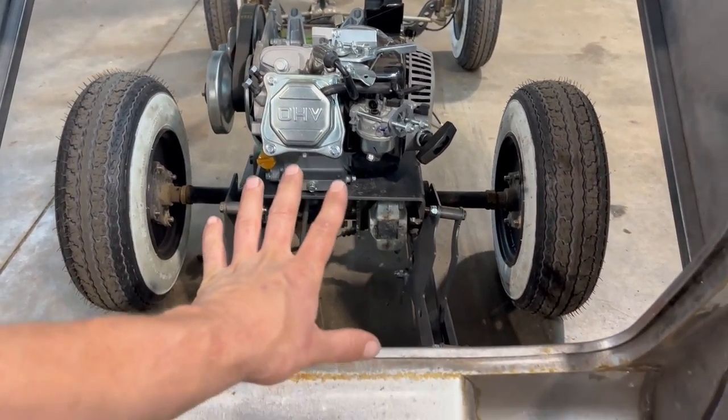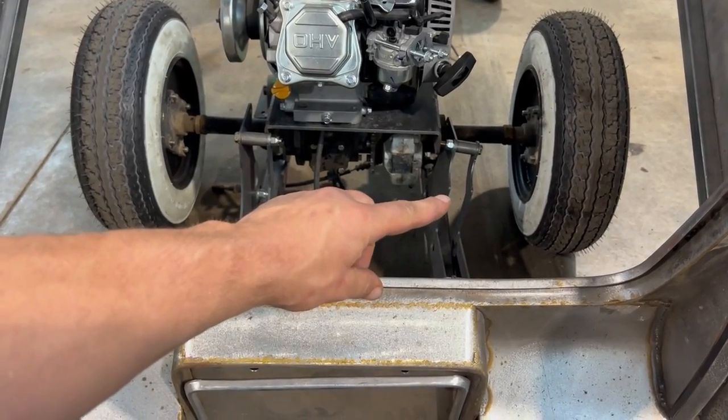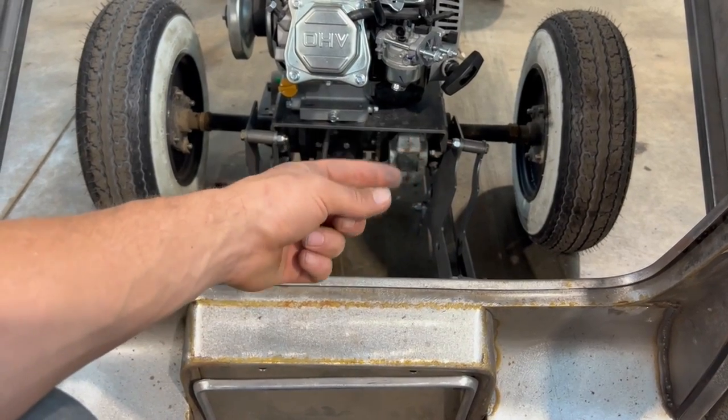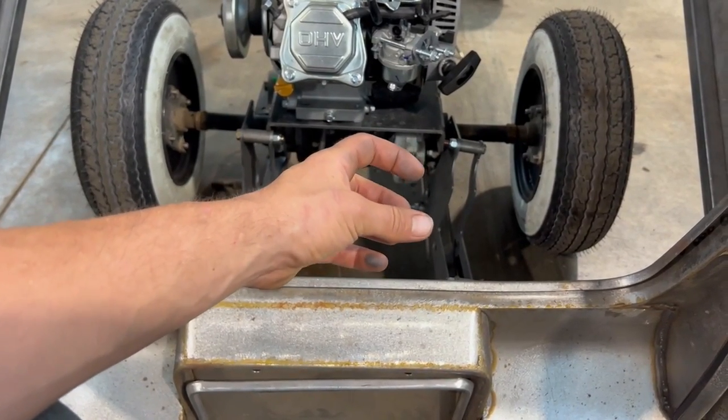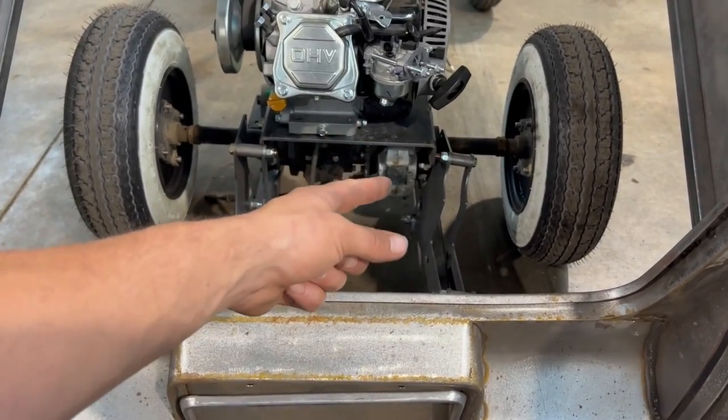What I could do is recut these plates and move the tube hole far enough away that it misses the back of that brake caliper. Then the tabs that I've created may also have to be modified to reach the spot where we want them to be.